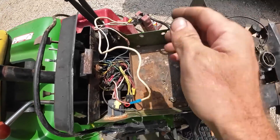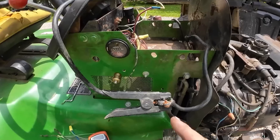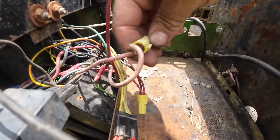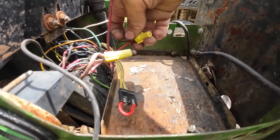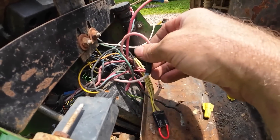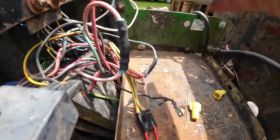We've just got it on the jump pack. Here's what I've learned so far: this is a ground for something and this is a ground loop that's not in the best shape, so I'm going to redo that with a butt connector. This is also a ground loop for something - so these are cleaned up a little bit better. I don't think they're to a purist's satisfaction level, but for a shade tree mechanic I think they'll be just fine.